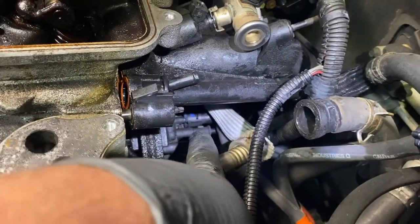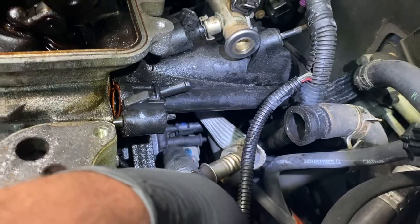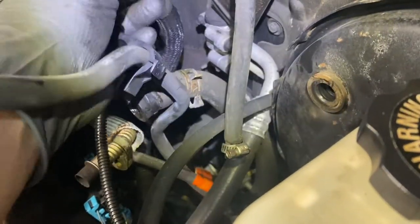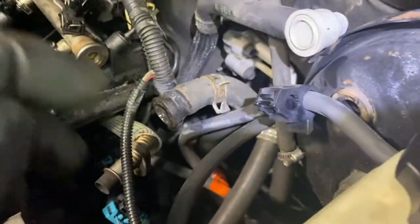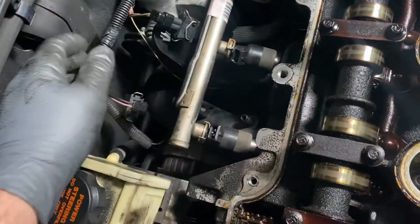But I'll make sure. We're on the top again. Here, that's the vacuum line on the bottom I told you about. It's this one right here. Just push that out. And instead of releasing that big hose on the bottom, that goes up right here to the brake booster, you just pop it out here like that. It's easier just to do this rather than going down on the bottom and playing around with that clamp. All right, now let's see if she comes out. Okay, so basically it won't come out. It's hitting the firewall.